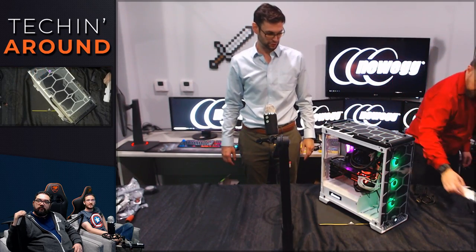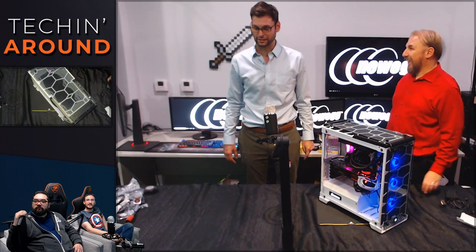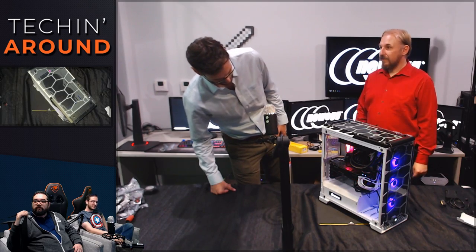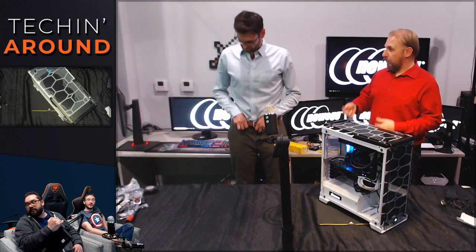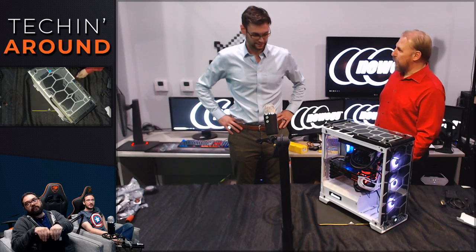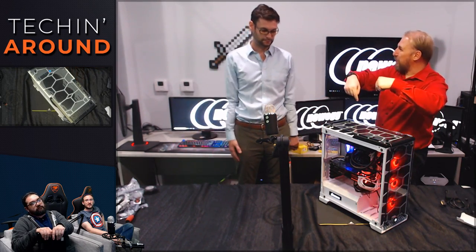We'll post some more pictures of this thing, because it's a hot mess, I'll tell you that. If you want to see really nice components thrown together by a couple of monkeys, this is the poster child. It was a lot of work to undo the stuff that Bill was doing wrong. There were a lot of handful moments, like, that's the PCIe cable. Yeah, whoops. You separated the two PCIe channels, and then you put two different cables from two different lines.